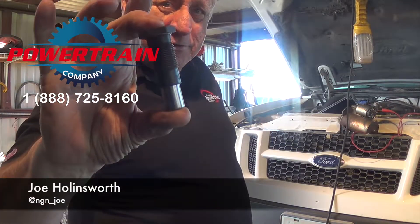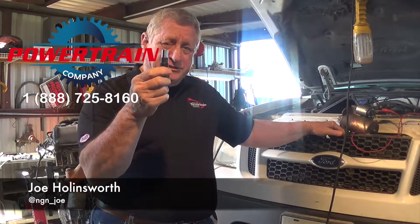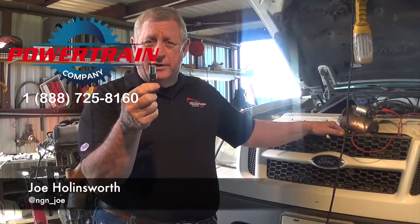They get a bad reputation for one reason, and that's this little spelunker right here, folks. That's your problem. This little bitty piece is called a hydraulic cam chain tensioner, and this is what causes all the problems in this 4 liter overhead cam engine. If you replace these things at 80,000 miles in your 4 liter, you'd never have to do what we've had to do with this one, which is yank the engine out of it.